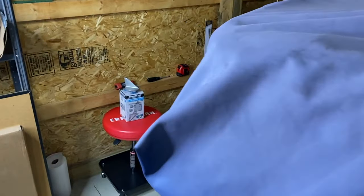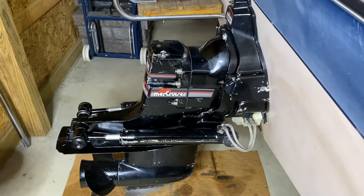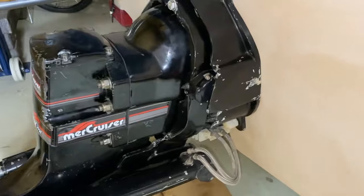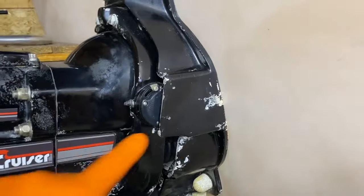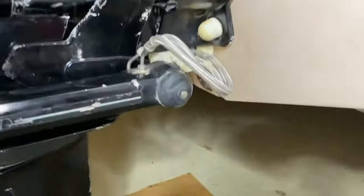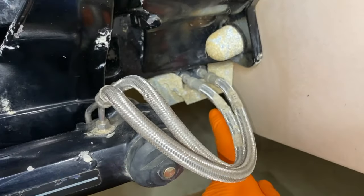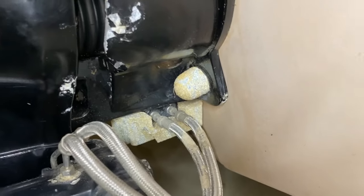Inside the garage, let's go to the back of the boat. Here is our workstation. If you have been with us the entire journey of our bell housing, bellows, and outdrive rebuild and replacement projects, that's awesome — we really appreciate that. What we'll do is feed off the transom. We've got our transom, gimbal ring, bell housing, and the outdrive. We'll come inside here where the hydraulic lines off the trim ram feed into their hard-mounted fittings. We've got a lower bell housing anode down below, and then we've got one of these small ones on either side of the lower transom.